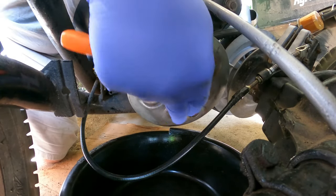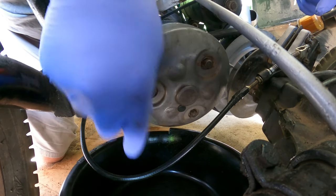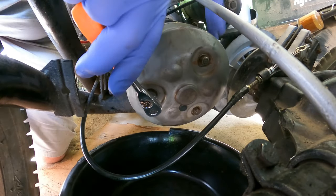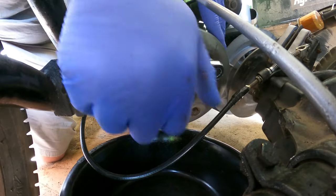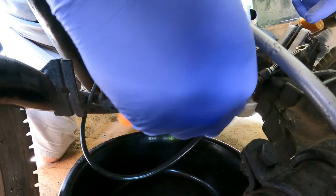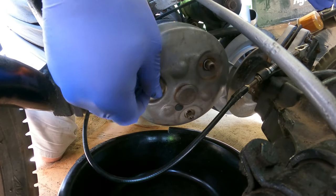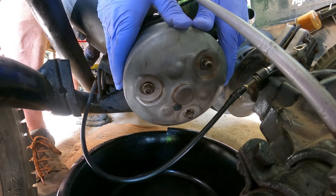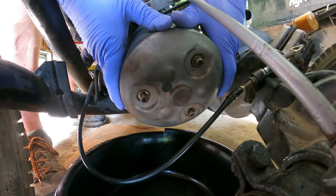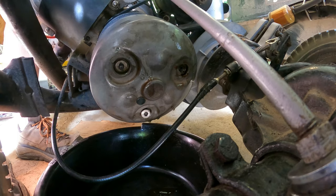There's no way to drain this — you can turn it down to where this grommet is, but not really any fluid is going to come out because it doesn't hold a lot. The first thing we need to do is take these three bolts out — the nuts — the heads are seven-sixteenths. Don't take them completely out; the main reason is there are springs behind here so you don't want it to fly completely off.